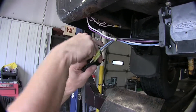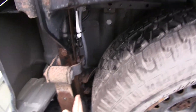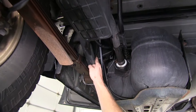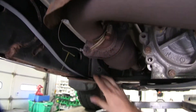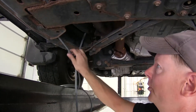We'll use some electrical tape to protect our connections, then run our gray cable up to the front of the vehicle. Make sure you stay away from anything moving like suspension components, or anything hot like the exhaust. We ran our wire up alongside the frame over the hitch and up and over the top of the frame, zip-tying it to keep it up and out of the way. We went over components, lines, and hoses, ran it down alongside the frame, through the space between the frame and the gas tank, over the gas tank brackets, and followed the frame where we could. There was a small opening to run the cable through, and then we ran it up toward the engine compartment, through a heat shield to hide it. Once pulled from the top, the slack is taken up and the cable is hidden inside.